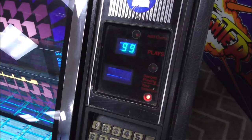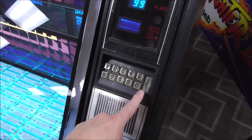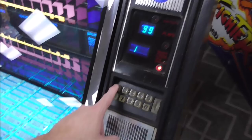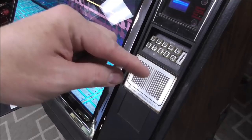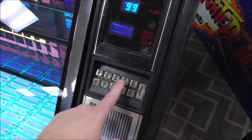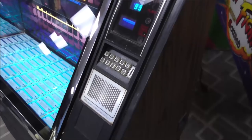You can see that it says 99 plays — the reason it says that is because we have set it on free play. It says 'your selection is lit up.' So if you put in a number, you have to reset. Like if you hit 8, it does that, because none of the records start with 8. The keyboard wasn't working very well, so we took it apart, cleaned everything. If you take the buttons apart and clean the contacts inside the button, it makes it work flawless. Every one of the numbers is very responsive.